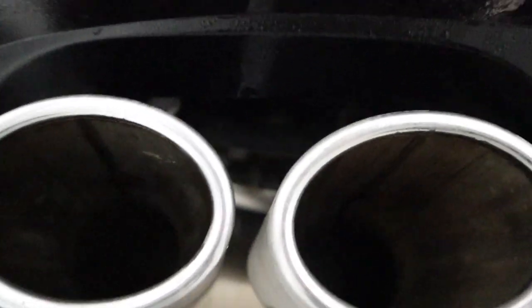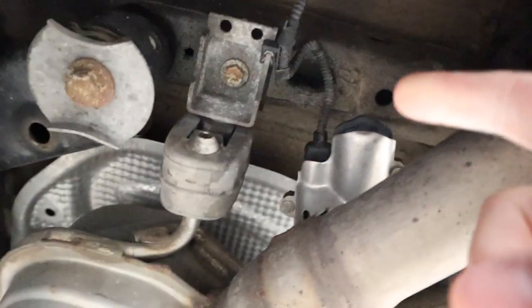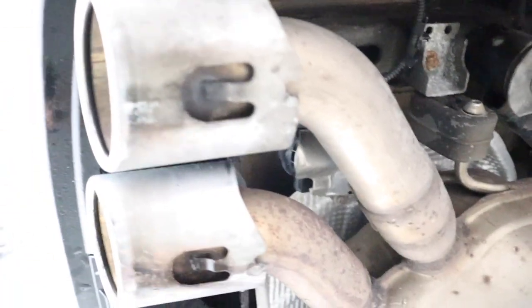It's pretty straightforward. If we head over to the car and look underneath, you can just about see the valve up there. All we do is literally disconnect that, route the cabling up behind the heat shield — that's where all the cable ties come in handy. It clips on there, cable tie the harness out of the way, and around here you've got the other exhaust flap. It's literally just a case of unplug factory valves, plug in the new harness. There's a dummy plug that goes on one side so the original harness doesn't throw any errors.